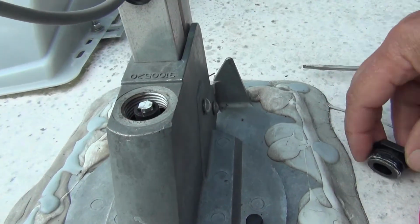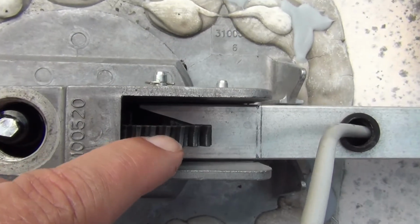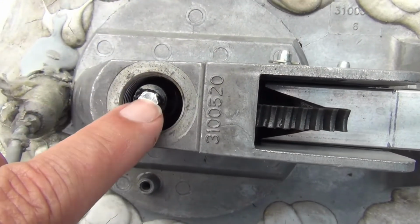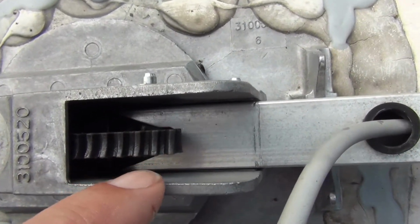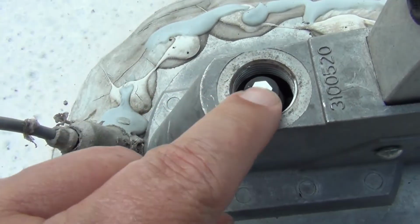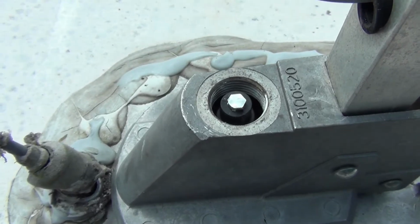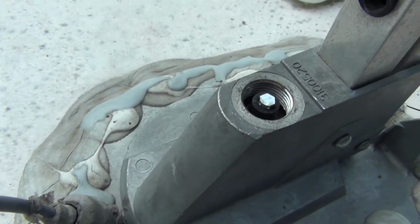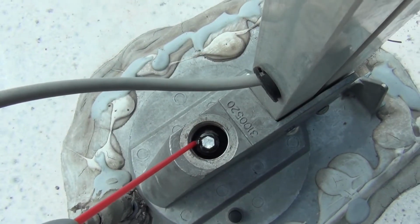You will see the top of the shaft that goes down to the hand crank inside the camper. There is a worm gear on it that engages the elevator gear, which lifts and lowers the antenna. Check both of these gears for damage or excessive wear. In a majority of situations, the only problem you will have is like what I have here. The antenna mechanism just needs to be lubricated. Spray the silicone on the worm gear. Give it a pretty good shot.